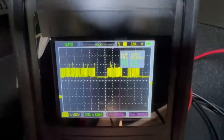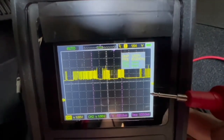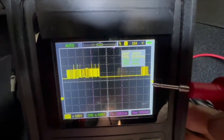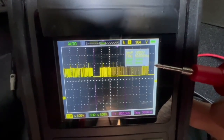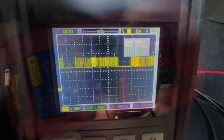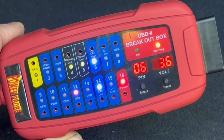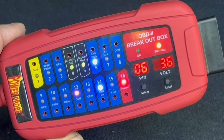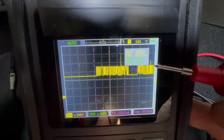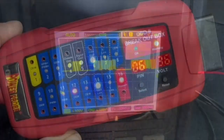With the scope connected to CAN high on pin number 6, you can see the CAN high signal is approximately a 1 volt pulse that starts from a low voltage of about 2.5 and goes up to a high of around 3.5 volts. The PP-ECB voltmeter will display the max voltage number, so an appropriate CAN high reading should be somewhere between 3.5 to 4.1 volts. You can see here on the scope the top voltage is approximately 3.5 volts, and indeed the PP-ECB meter is showing 3.6 volts.